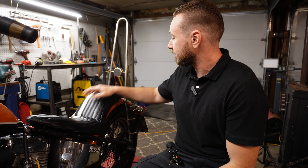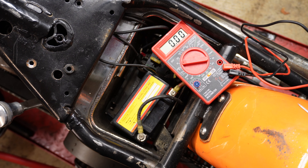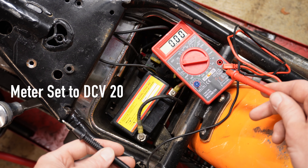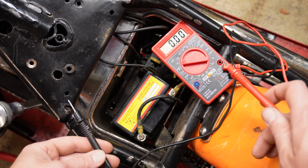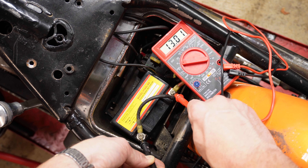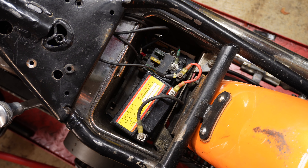What we're going to do today, I'm going to pop this seat off right here, and I will bring you guys in close up on the battery and show you how we test it. We've got the seat off. We're looking at the battery from the top down. The first thing I want you to check, if your bike isn't starting, is your battery voltage. We've got our voltmeter right here, and it's set to DC volts 20. I actually have a whole video showing you how to use a voltmeter to test all your electrical systems — that's a deeper dive. Today I'm just showing you the basics. Red goes to red, black goes to black, and you can see we are getting about 13 volts on our battery. What you want to see is 12 or more. Then you can fire the motorcycle up and test the battery while the bike is running, and we'll do that now.